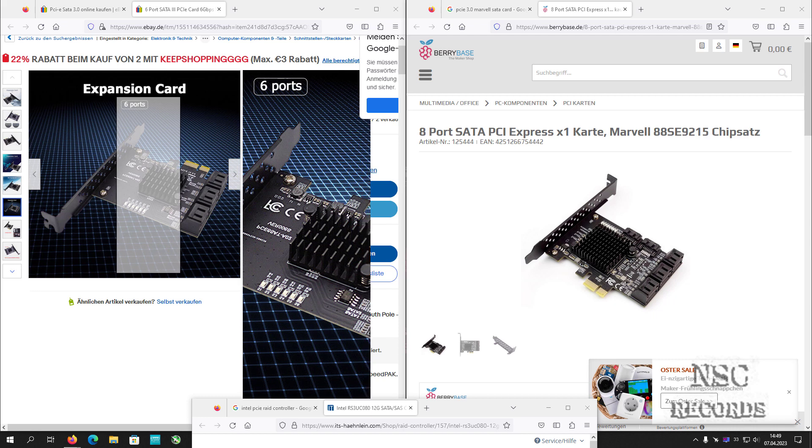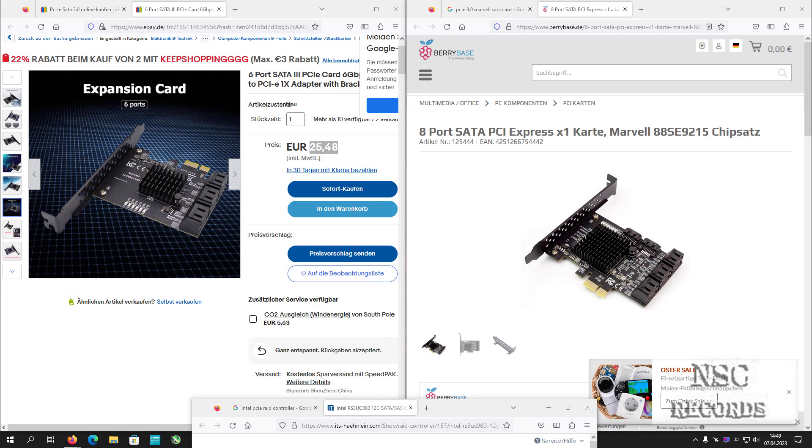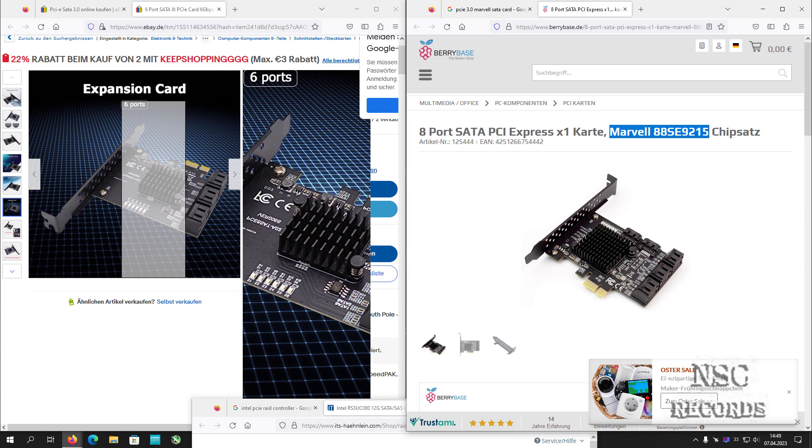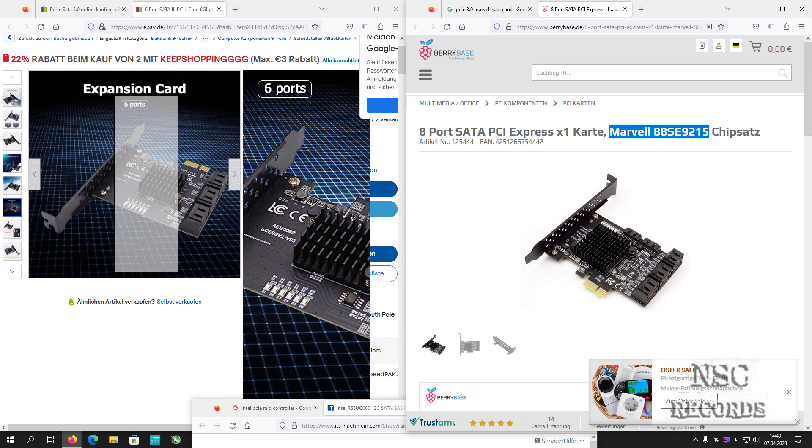Sometimes it's just not detecting my hard disk drives. Now the card here on the right side has a Marvell chipset, which means you can also make some RAID systems. If you love RAID 0, then you're good to go with this card. But on a single hard drive it's reading a bit slower - the maximum here was about 380 megabytes per second on PCI Express 3.0. Compare that with the left card: on PCI Express 2.0 you get about 400 megabytes per second read speeds.